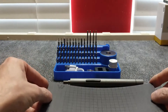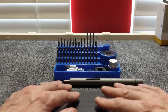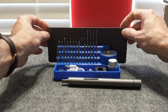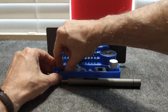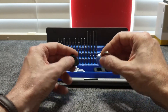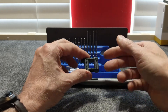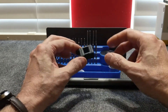The included magnetic screw pad has a grid layout and allows you to lay out screws in the order and orientation of how they came out. The pad is also rather thick, has a good weight to it, and seems well made. Having the included pry tool and suction cup is a nice bonus, especially if you work with cell phones or anything requiring you to pull a screen off. The magnetic tip magnetizer and demagnetizer allows you to make the tip either magnetic or non-magnetic depending on the situation — you may not want a magnetized tip if you're working on a hard drive, for example.